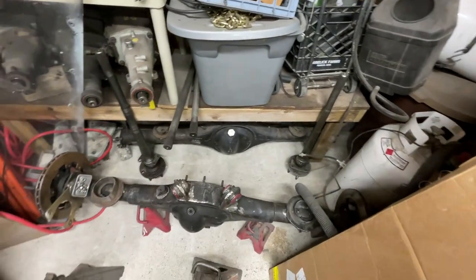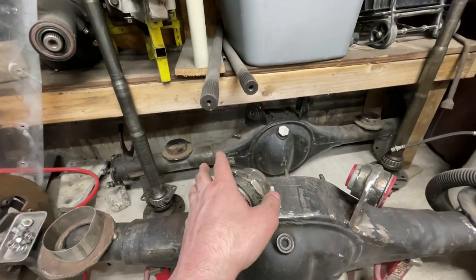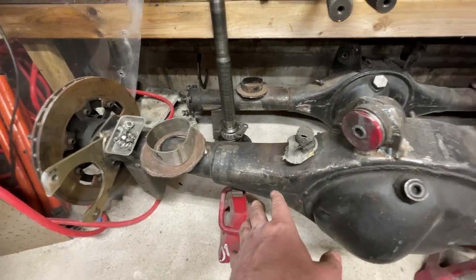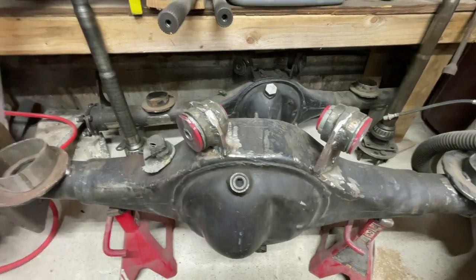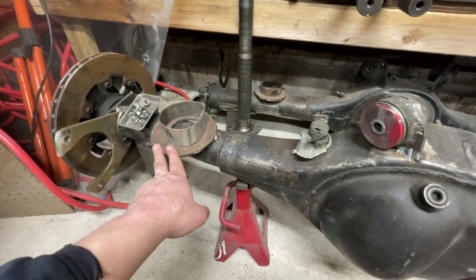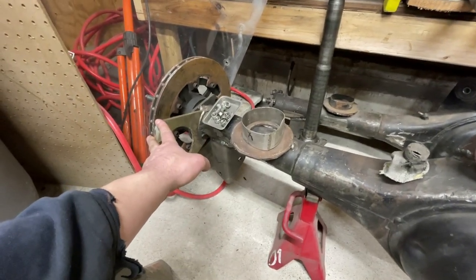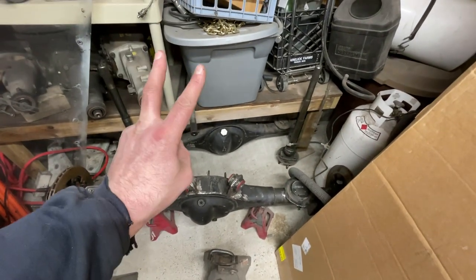You can see these two rears sitting here — both Ford 9-inch rears. I redid the lowers on my bolt-in axle, which is legal for another track, and I put new bushings in it. For my floating rear, which is not in the car because I think we're going to have fitment issues, I redid the upper mounts. It's raw and ugly looking but it fits my fixture and fits in the car really well. I still need to do a lot more measuring to make sure the wheelbase is even and it tracks straight, and the caliper mounts might be a little tight to the frame.